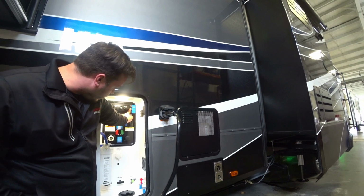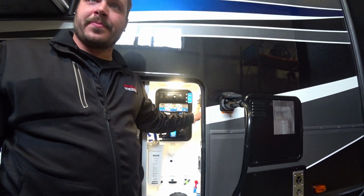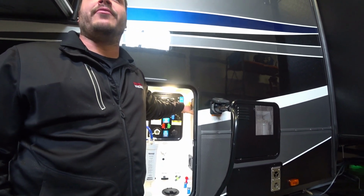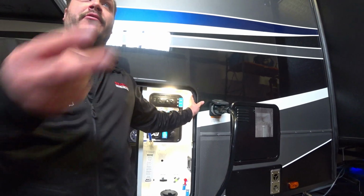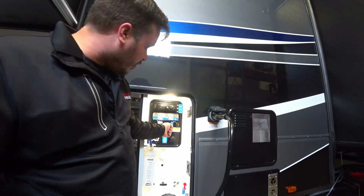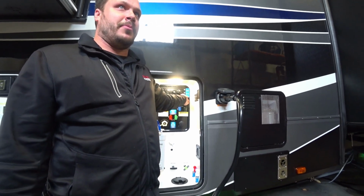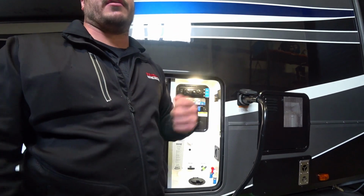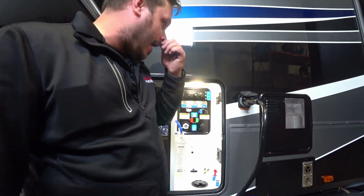So if you notice, you have cable here, and then you have satellite for living room, bedroom, garage, right? The way satellite is run nowadays, you have to have an individual line going to each television. Now, I know with those dome satellites, you can only run up to 2 boxes. So you'll have to say, I want it in the living room and in the bedroom. Now, if you want to put it outside or in the garage, you'd have to undo one and transfer it over. You have to run a direct line to each satellite. You can't just plug it in and every TV gets it.